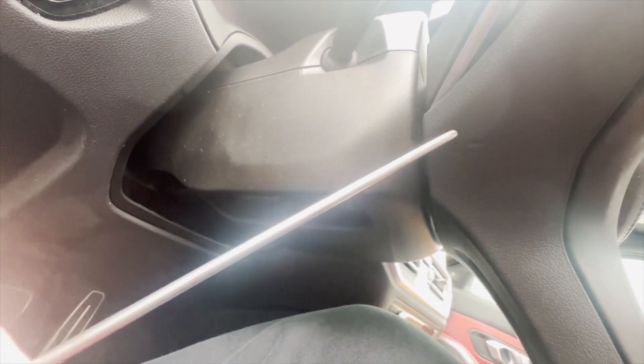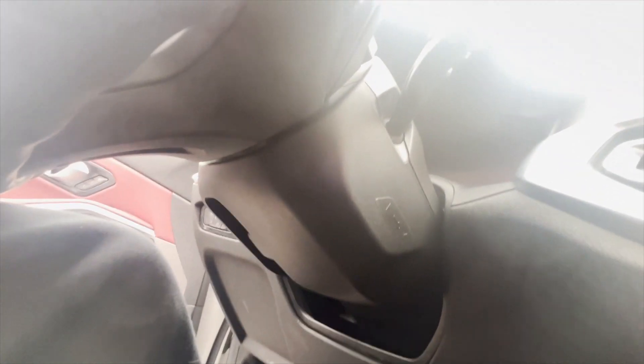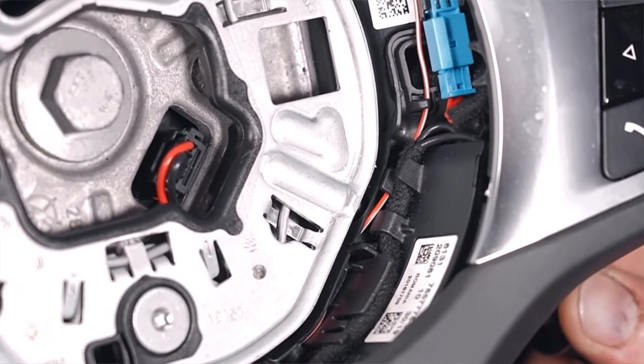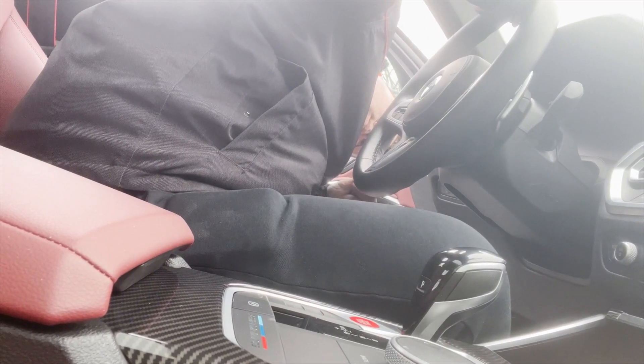Now, what you gotta do is go back inside your vehicle and locate two little lines on the back of your steering wheel. They're both on the left and right sides and you will need a screwdriver that has a flat top. Sometimes what people do is they cut off the top of their screwdriver to make it flat, or anything pretty much that has a flat head. Now what you gotta do is gonna make a hole. There's gonna be this channel and a rod that you literally have to push, and this rod is gonna release the airbag.